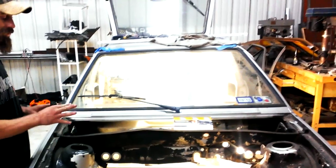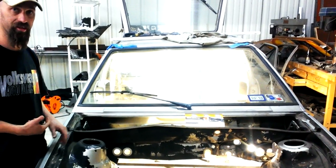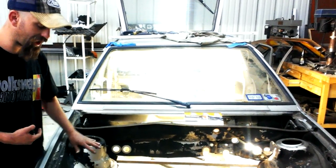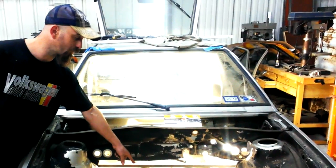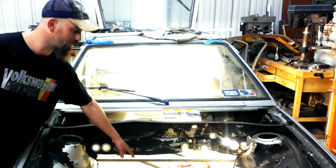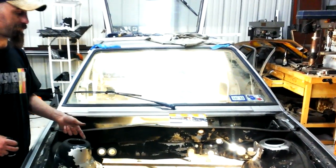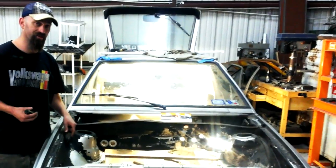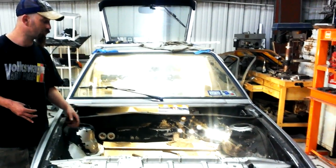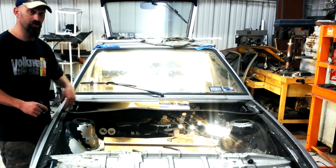Once all the unibody fabrication work is done, we'll get a TIG welder, and we have a guy that'll come in here and make a really nice cage for this thing, and he'll reinforce from the hat to the frame stubs to the hat with 1-inch 4130 chromoly round stock that's going to reinforce the steering rack. When we do the swap, the Mark 1s and Mark 2s have the steering rack on the unibody structure. Since we're using the TT, the steering rack is now on the lower cradle, so we no longer have all the equipment on the firewall, and we'll have a smoother firewall as well.